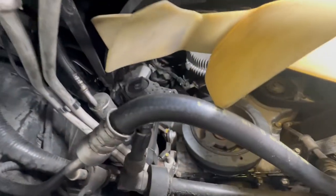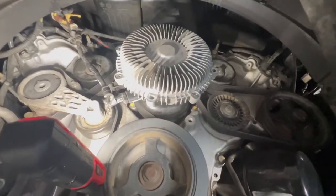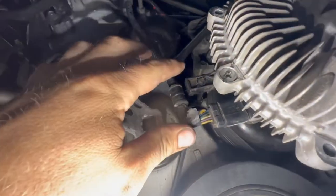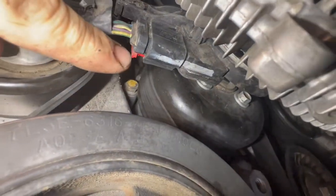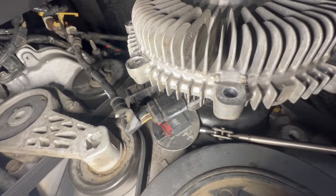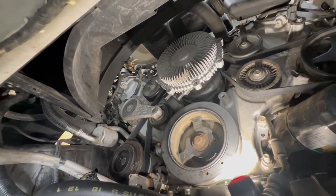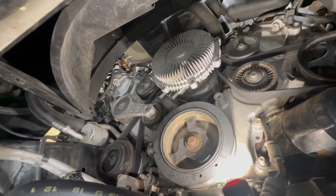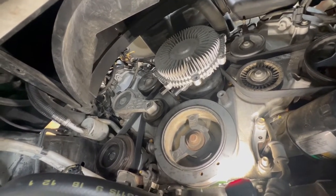It's going to be a little bit of a tight fit, but it comes up. We got our fan off of our fan clutch. We got to undo our wires to our electronic fan clutch here. You have this clip right here that clips around this — you undo that. You have the red release tab right here, you push that tab in and you pull the connector off. The best way I like to approach this is I don't use fan clutch tools on fan clutches — I use an air hammer. It's much easier, it's less of a fight and it usually breaks it right loose.